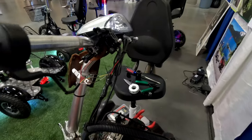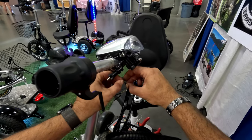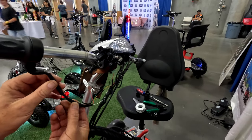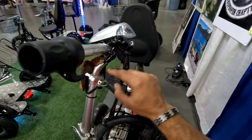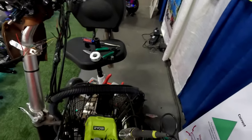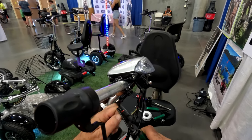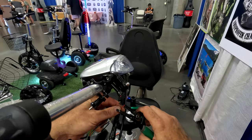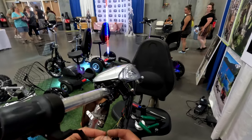You could just crimp these but I just can't bring myself to do that, so here's how I do it - though crimping would be fine. First of all, I put two pieces of heat shrink on here so that if one's not long enough I can overlap them. Make sure you put your heat shrink on first, because if you solder it and then say 'oh I didn't have heat shrink' - guess what you'll be doing? Cutting and soldering it again. The fuse is out. I'm going to go ahead and make it even on both sides - about a half inch is what I use. You may want more if you're new to soldering. Here is just the Steve method.